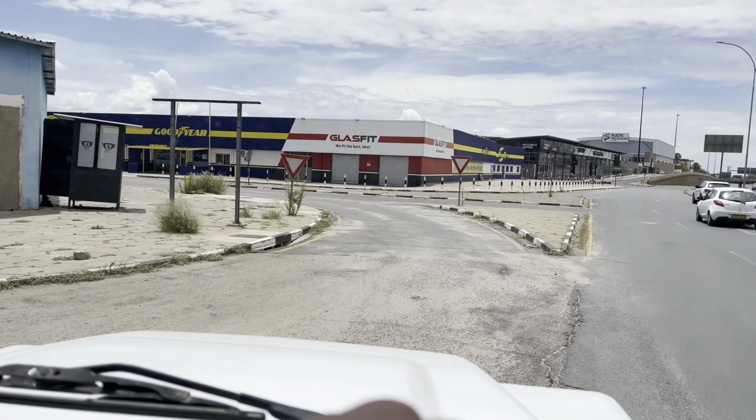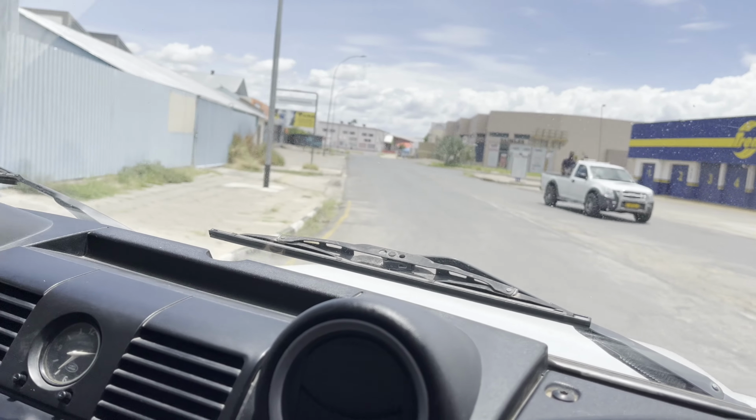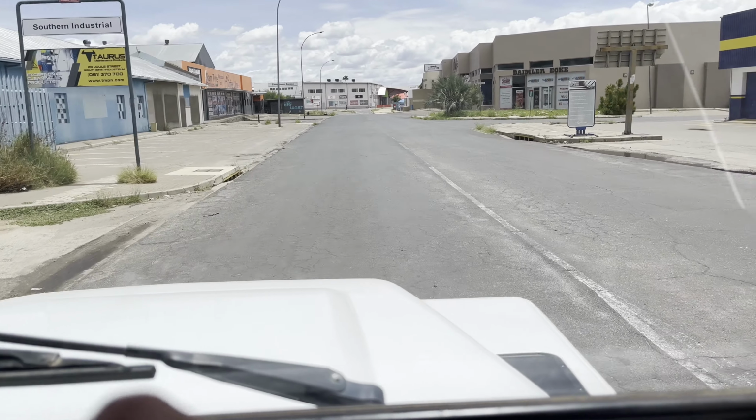As you guys can see, we have a driving car. So, finally, got it done. Just quickly taking it to someone to encode the new injectors onto the ECU, because they have special serial numbers or whatever and need to update the ECU so that you get fuel correct. But yeah, I think that is pretty much it for this video then.